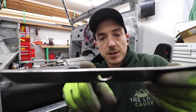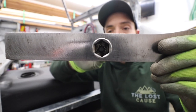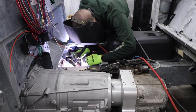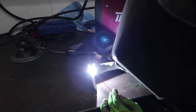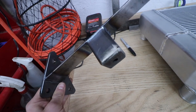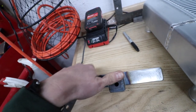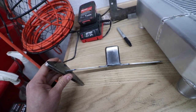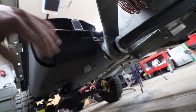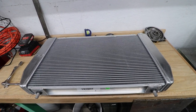That little square tube on the fuel tank will go right over this hole, and that hole is provisioned to stick the socket through so we can actually bolt this guy on. So there is the start of our front fuel tank bracket. Eventually we'll do some holes and some threaded inserts to hold the skid plate and some additional bracing to other parts of the chassis. For now this will hold the tank in place nicely — that'll work out great. We'll box this guy in later on and we'll be able to have an aluminum skid plate mount to that. Sturdy, sturdy.